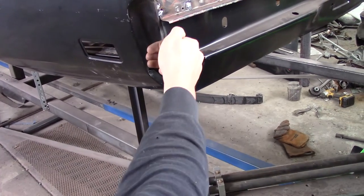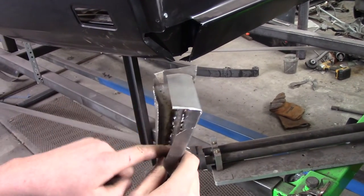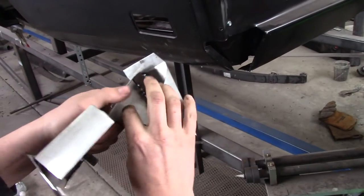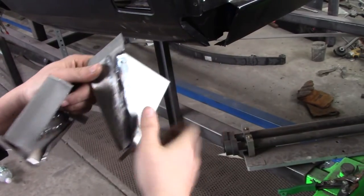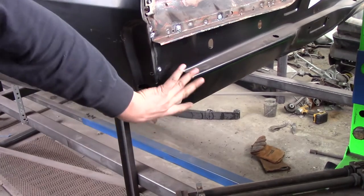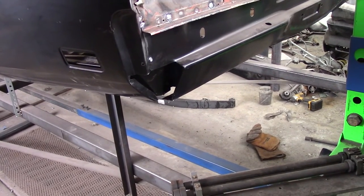On a Charger the real ones are very rounded, so I welded a strip of 16-gauge — nice thick metal — in the back. I tacked it all in there, and that's giving me enough meat to grind away the edge. I'm going to grind away the edge, run that out, and I've got that nice piece still in there. Then I'm going to form it with welding until it's the nice bevel shape I want it to be. Once I made one pattern it was really simple — I made the valence pattern, and then you just make the inverse of it. I copied them, so it went pretty fast. That's what I did over on the Studebaker too.